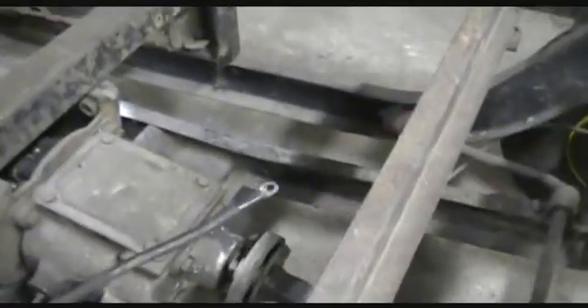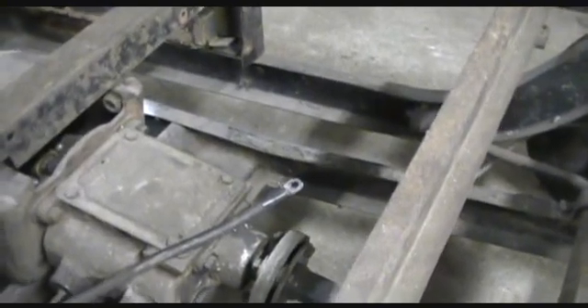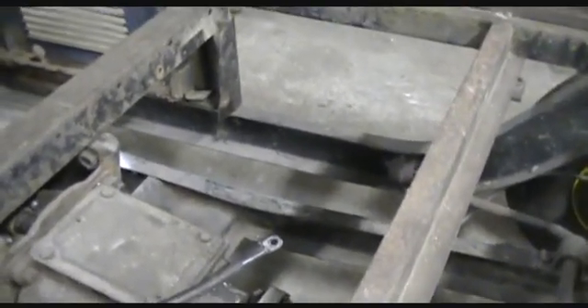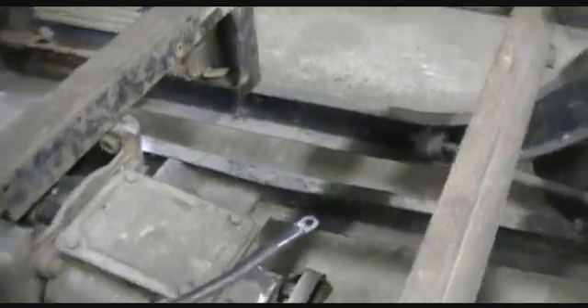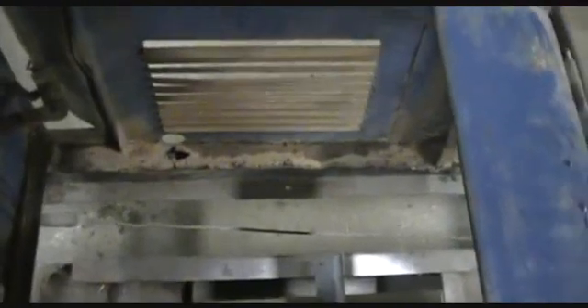I can't mount directly to either of those — I have to mount to one or the other, not both. And I have to leave enough clearance for the suspension to travel anywhere I leave components, which makes this a bit of a pain. The final option I've considered, which is an okay option, is to stuff them inside here the long way. Trouble with this is I can't fit them all — I've only got enough room for 7 batteries per side.